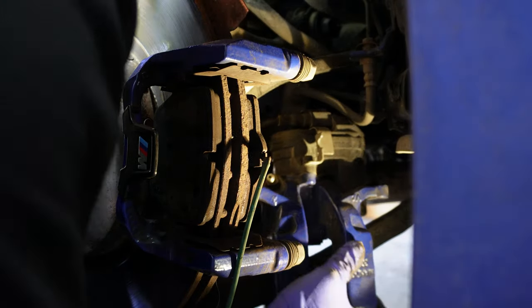You can see there are some worn spots on the rotors. It still yields the same performance as the day I installed it, so I'm not too concerned about the worn parts. If I feel like when I step on the brake pedal it gets wobbly, like I can feel the grooves inside the rotors, then it's probably an indication for me to change it, for the front one at least. But currently the back ones look fine, and up until this day it still looks the same as how it shows on the video right now.